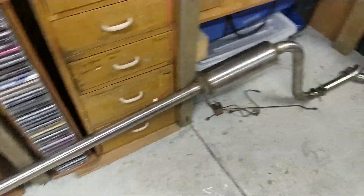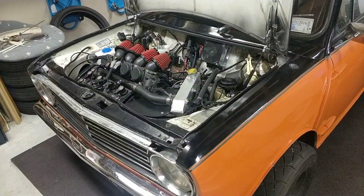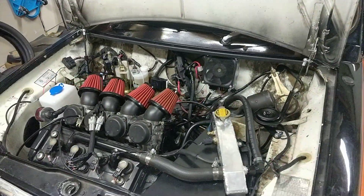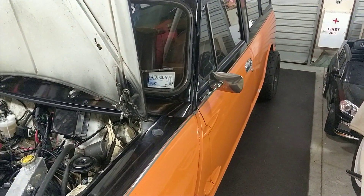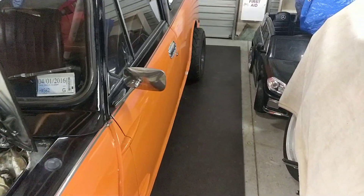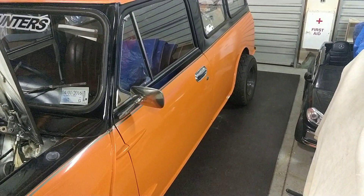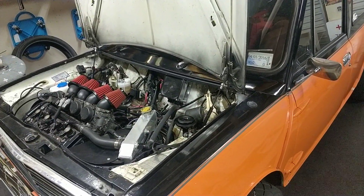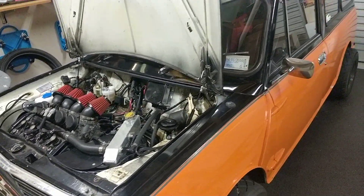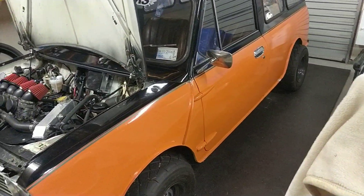It's pretty loud. The car isn't running at the moment because I've had to take all the fuel lines and everything out to get the subframe in, and I also needed to make new brake lines for the rear, because the mounting of the rear proportioning valve is different on the beam subframe than where the brake lines fit.